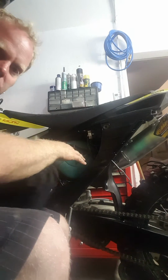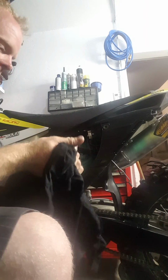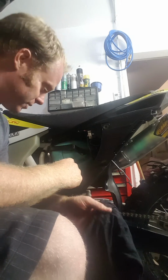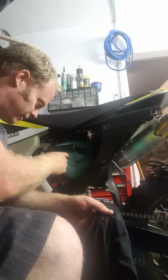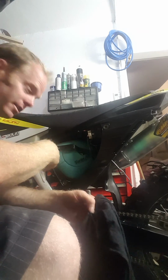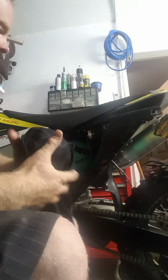And then also make sure that you clean the inside of the airbox as well. You don't want there to be dust there. And what I actually do is in the intake there, I spray a bit of oil. So this is like a secondary precaution. So if any dust would get through here, hopefully, if it's so fine, it will stick to the inside of the airbox. But that's just me. But yeah, so anyway, that's all fitted now.